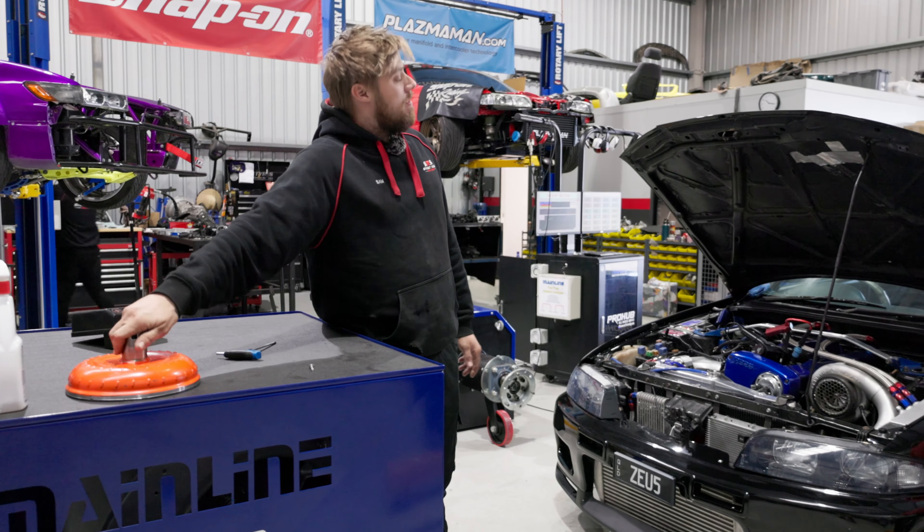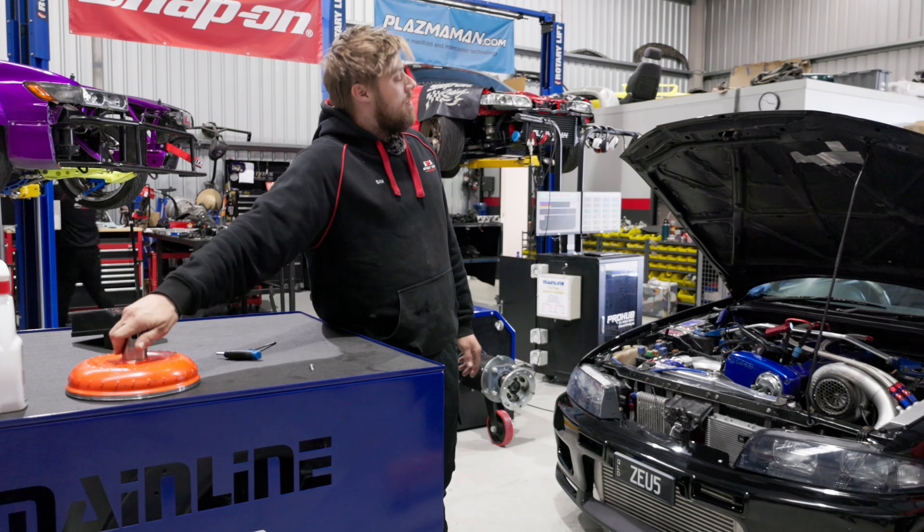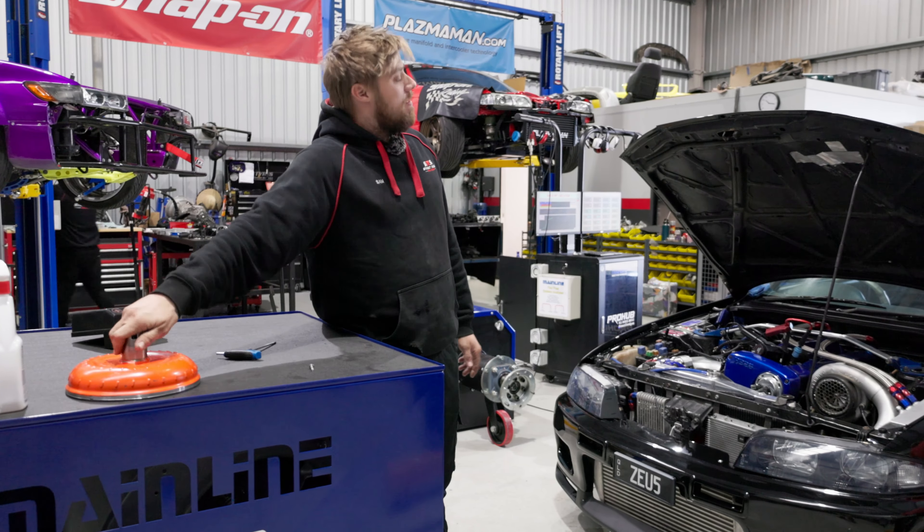We get him to start it up and we look for 20 degrees - what we're looking for is the timing mark on our balancer and the timing mark on the timing cover. Once locked at 20 degrees in the ECU we should see those marks line up. We're going to do the baseline for what was actually in the ECU, other than the timing which we just corrected on the engine side. It's in closed loop boost control, which we predominantly use open loop, but we'll just see where it goes and how it reacts.